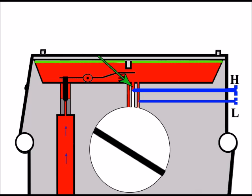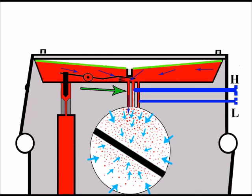And we'll get the same problem, by the way, if the high screw is screwed right in. As you can see here, there's no debris at all. It's just that someone's reset the high screw too far in and no fuel can come down into the venturi for the engine. Okay, let's have a look at another scenario.